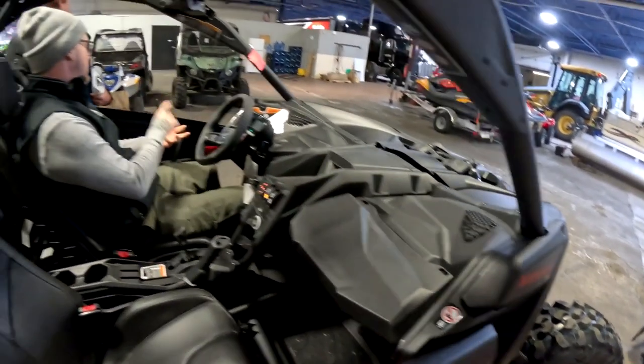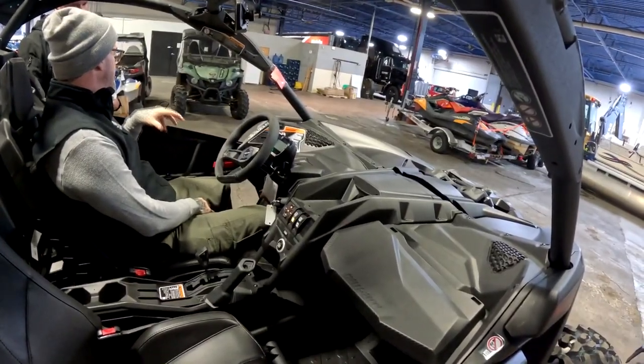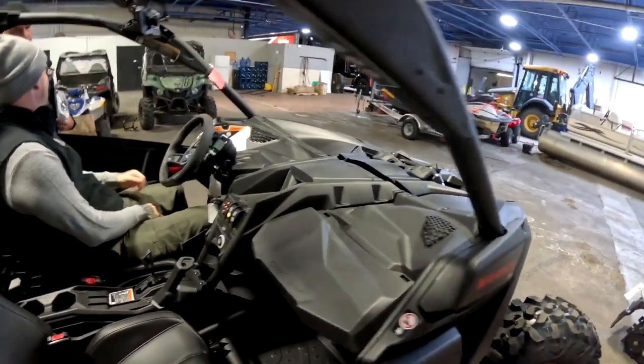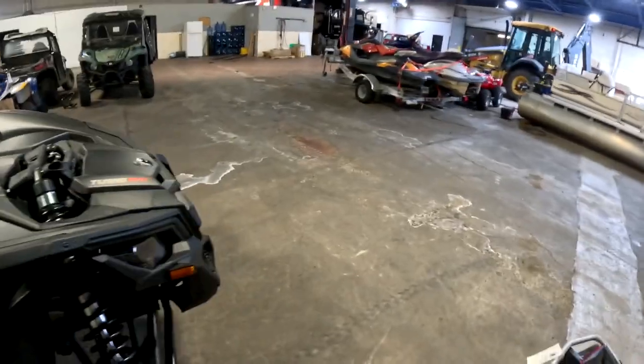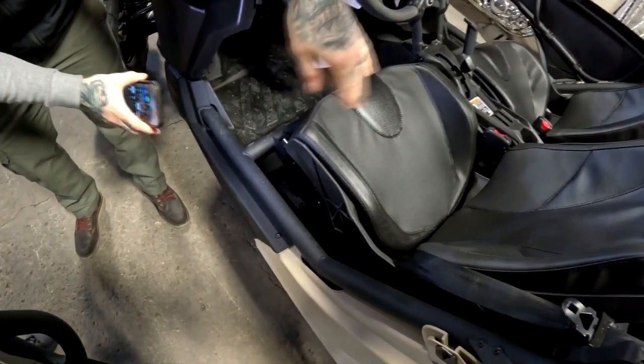pushing, pulling, climbing, anything that's going to be putting the machine under any kind of stress, if you're riding around under 25 miles an hour, low gear. That's going to help your belt life. Drop your bracket up or down, that'll change the pitch of your seat.